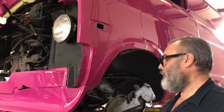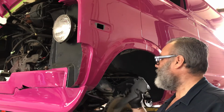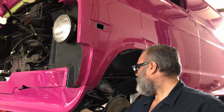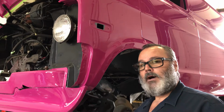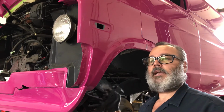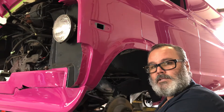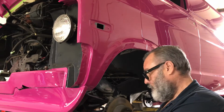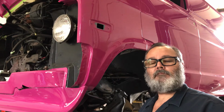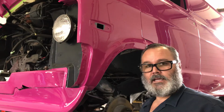On this van, what we're going to do is take the control arms loose, and then there's three or four bolts on each side of this K-member that bolts the engine cradle to the body. You can take them bolts out and then put a floor jack in there, maybe two floor jacks. Then you can lift the body of the van off of the engine. You're not working over the paint or anything like that.